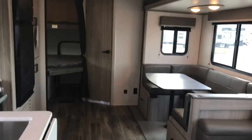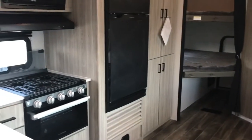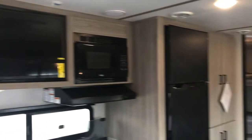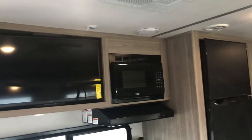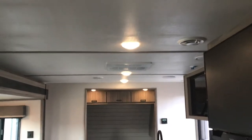There's a wardrobe on this side and another one over there, plus storage cubbies with nice hardware. Here's a real-world note on solar: people think you can just drive down the road trickle charging from your truck and run your fridge, but there's not enough juice coming through that little seven-pin connector to keep up with the fridge. You only find that out on a long trip when your battery runs down. The solar keeps your battery from going down and your fridge running. It goes into a solar charge controller and is being used right now with no battery — it's a very state-of-the-art system.